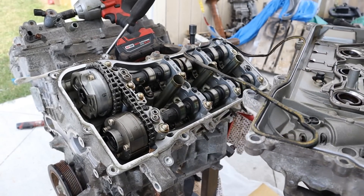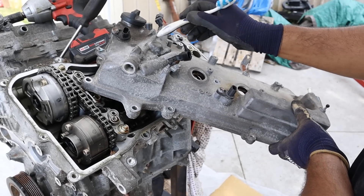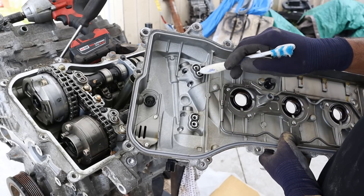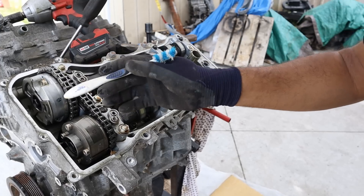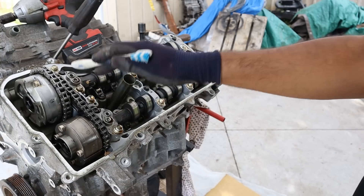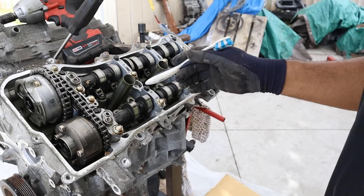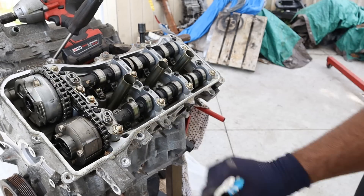Wow, that's really really clean. Taking a look at this interesting valve cover design — obviously Toyota can't use a plastic valve cover because you've got oil channels in here that come up from that tube to feed your two VVT gears. Underneath you can see the two solenoids that distribute engine oil pressure into two little holes which fill up these two cam phasers. One thing I don't like about this design is the fact that you've got to bring oil up into another piece — the valve cover — which opens the potential for leaks and loss of oil pressure. Most engines suffice with sending oil pressure through the camshafts themselves and up through the head into the VVT gear without involving the valve cover.